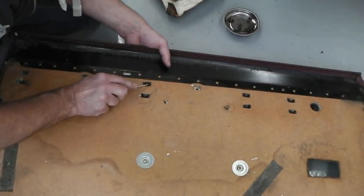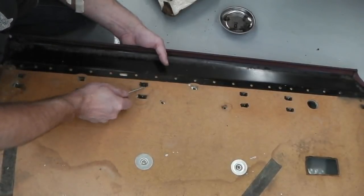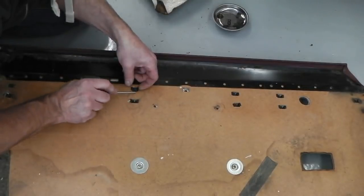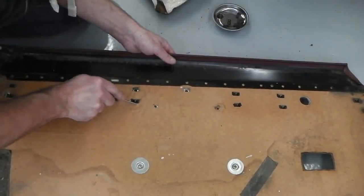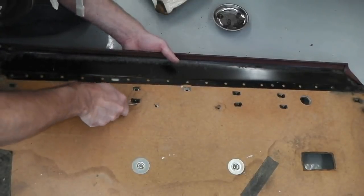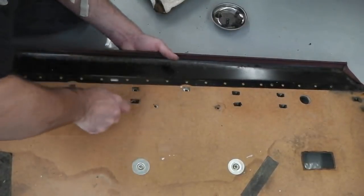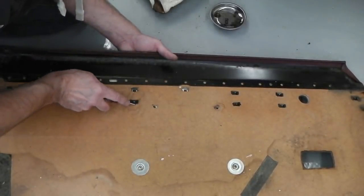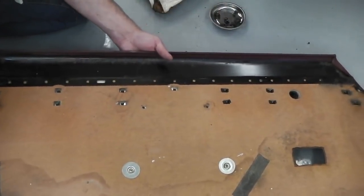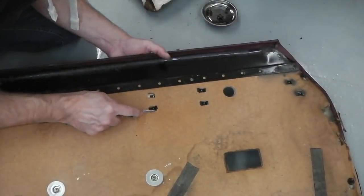These are going nice. If they're going nice, you can stay on. And it's not like keeping you on when there's no action. It's all about the pick. And they are reusable. We're not damaging them. For some reason, this door card survived a lot better. So you can see, it's the same procedure for this door card. There's another two. That one's missing. We've got one missing clip, moving it across into your centralised view. Going good with this type of pick. Just use that type of pick.